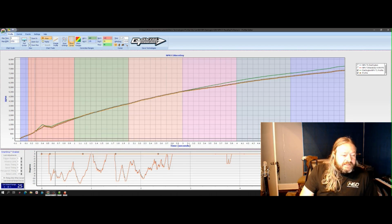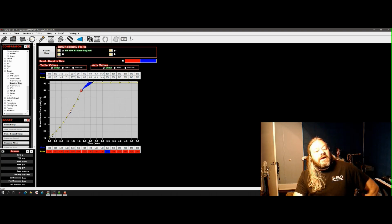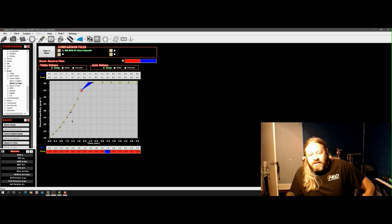Now, let's look at the Holley. See the same thing. If you look here in the boost map, down low, I'm not changing anything. And you may say, all right, well, that's crazy. You just spun like crazy. Yep, but the track is changed a good bit, and I'm banking on the wheel speed being a lot tighter down there and not needing to change much, right?